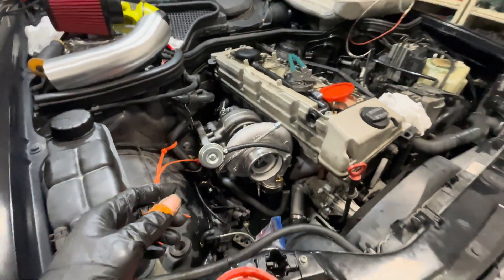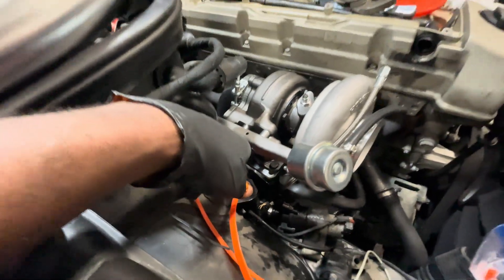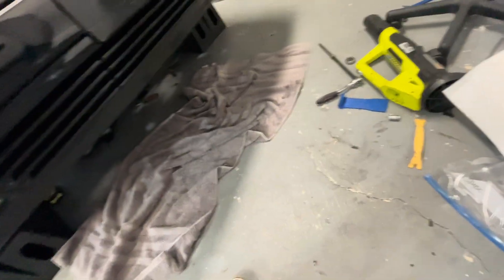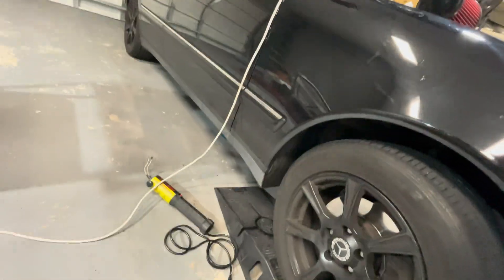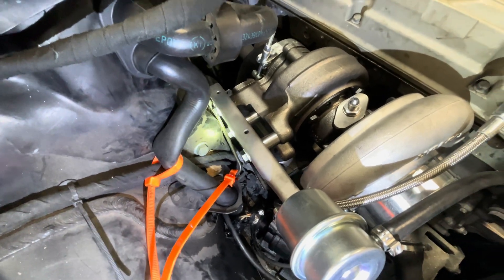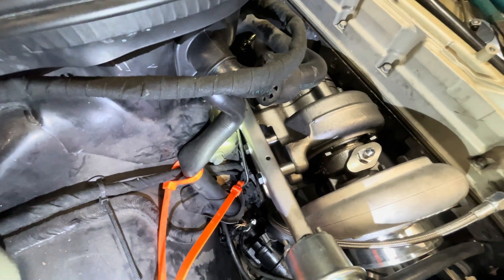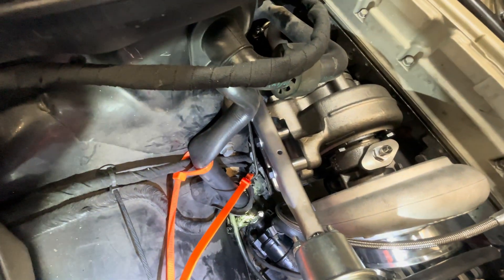There's just like debris from where it was cut — clean it before you stick it on. Alright, I'm under the turbocharger. There's a lot of stuff that you actually have to move from here — the heat shield's in the way and the brake line is insanely close. That's the brake line right there — it needs to be bent multiple times to get out of the way before you put the turbo in. We just zip tied stuff out of the way. This cooling line right here is clearly kinked — we just pulled it out of the way for the time being. We're definitely gonna need to replace that pipe for clearance.